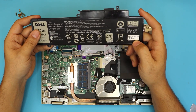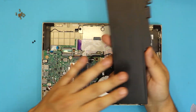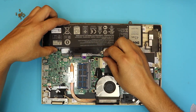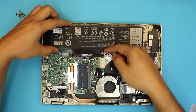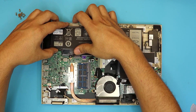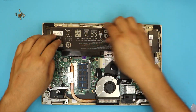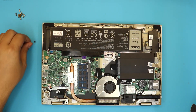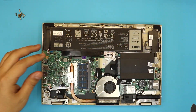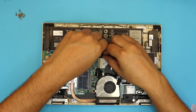This is a type GK5KY — that's the model number on this one. I'll leave the exact part number in the description, which also appears on the label. Now, for the new battery, put it down at the front end, pull the cable towards yourself a little bit, align the notches, and push down the battery towards the jack. Then put the two screws back in and put the cable back where it was running.